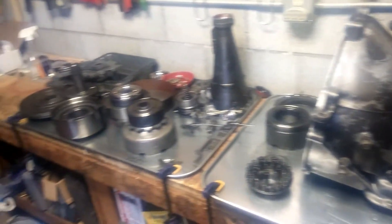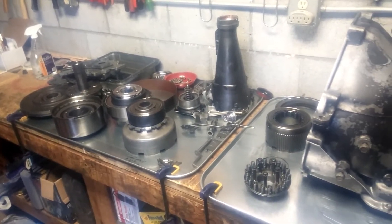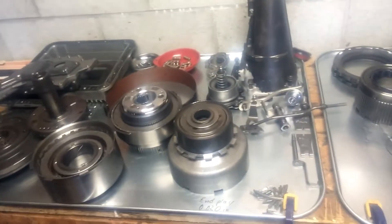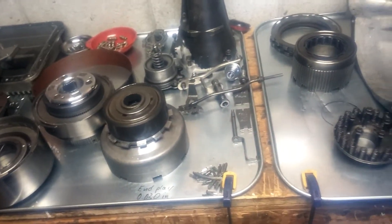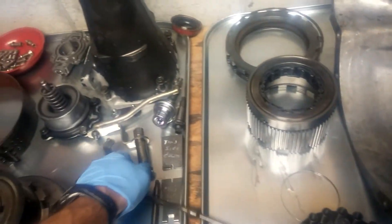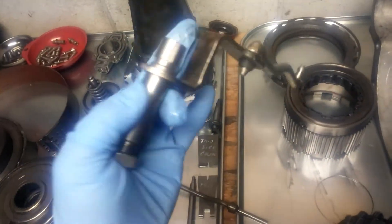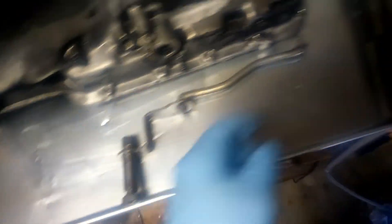So what am I doing right now? Maybe half a year ago I had a video on how to replace the seals on the manual shifter lever on the outside of a C6 transmission. There's a seal I replaced back then, but there was actually a second o-ring that they forgot to install - that's why it was leaking. This is the shifter shaft here in my hand, the new one I put in. I still have the old one.